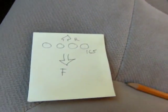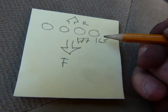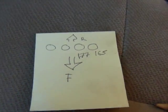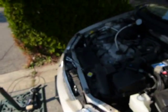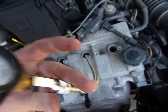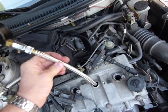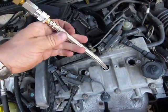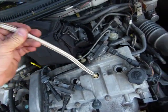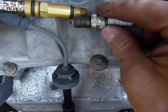What I do with that 177 is draw a picture here and record the information. Those are the four spark plugs — 177 here, the previous one was 165. They are close enough. I'm looking for a number from the specifications — I'll have to look it up online to see what this measurement should be. I just hand-tighten this gauge in, and there's a pressure release button on it. If the compression is up to specs and all four cylinders on this four-cylinder engine perform the same way, this engine is in good order.